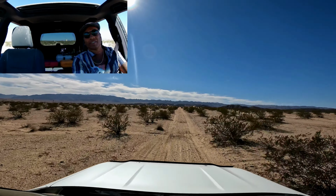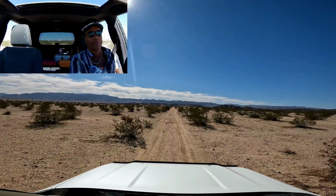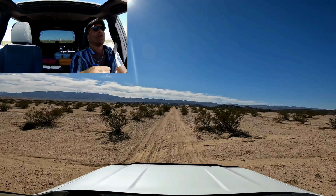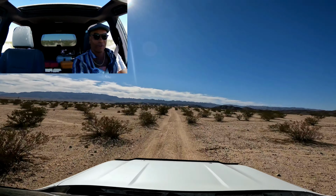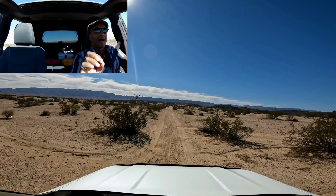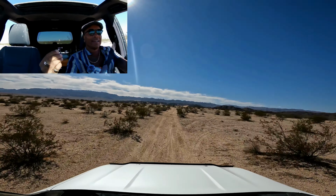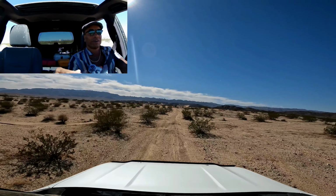I think we can all relate to the human body, right? And we can all relate to the human condition. You want your legs the same size. So same idea when you're going off-road. When you take this car off-road, put it in neutral, lock your center diff, and you're going to have both legs the same size. Now, can you off-road in full-time four-wheel drive?